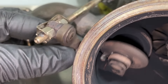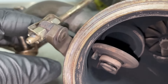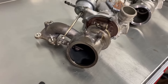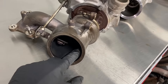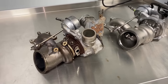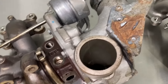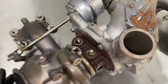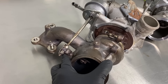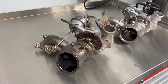The whole thing is just worn out and it only lasted 93,000 miles. There are a lot of pieces just rattling in the exhaust gases — that's what's making all the noise until the engine heats up, and then you'll typically just get it upon deceleration when this opens up and is sitting there loose. Generally the actual turbine wheel and compressor side have no bearing failures — the number one issue with these is the wastegate actuation system causing noise and P0299 codes for under-boost.